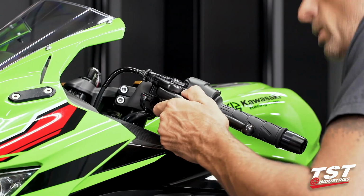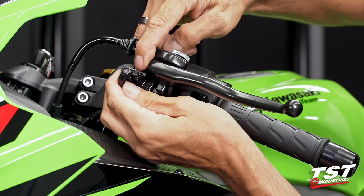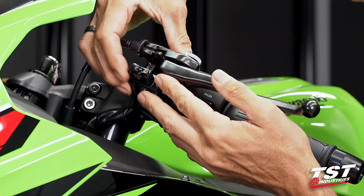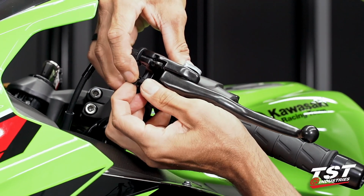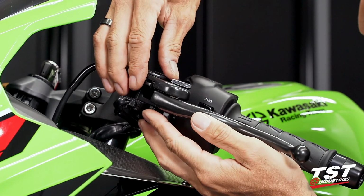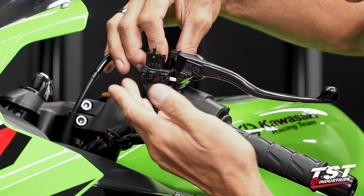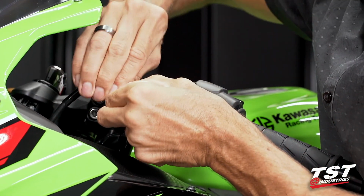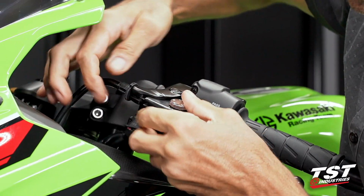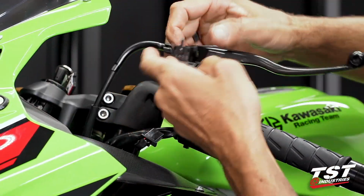Now with the perch loose, you can rotate up, and we'll focus on this connector here. It does have a locking mechanism. If you push this tab upwards, that unlocks it from its interference window. And then I will rotate it down a little bit to create some slack. This withdraws, and now we have access here. Before we get full access in there, let's align our cable slots here. See if we could get this cable out. No, we'll have to remove this switch body first.